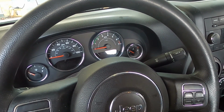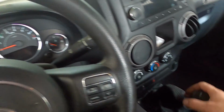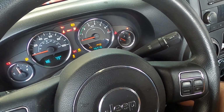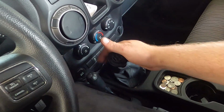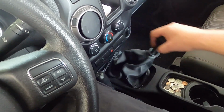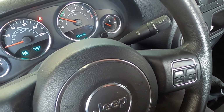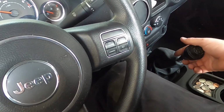So now the test to see if it works initially and you don't have to bleed it again is, if the trans is in neutral, start the vehicle. And if you can get it into gear with the clutch in, which I can easily, is first, there's second, third, fourth, fifth, sixth, and reverse, you should be good. That's the thing I like to test first and foremost: if you can start it and get it in gear, you have almost all of the air bled out.